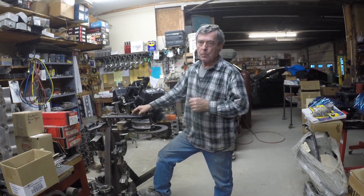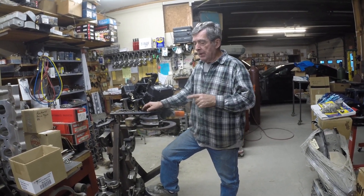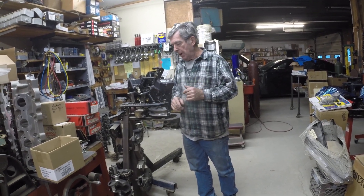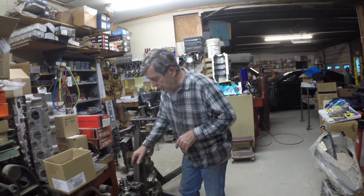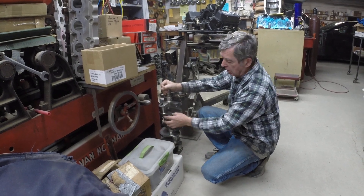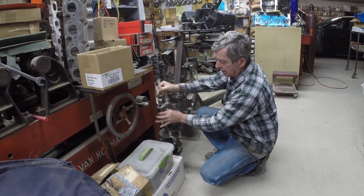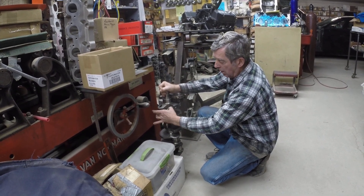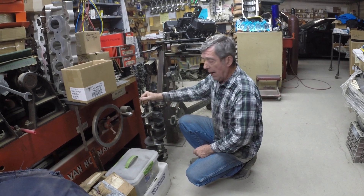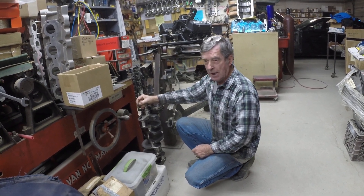To get a stroked motor, did the machine shop make modifications to the crankshaft, or did we order it with certain specs? No, it had to be made that way. Now there are people who have taken small block Chevrolets and run Honda Civic connecting rods in them — trying to spin 10,000 to 12,000 RPM. Short term, short lived, but it makes a lot of power. What they'll do is take this crankshaft — this one here happens to be for a big block Chevrolet — they'll take this journal and make it a lot smaller. They grind all off the backside and leave some on the front side. So what they did was take a stock stroke and by making the journal smaller, they removed part of the circle on the backside — now the stroke is longer. You can take a stock crank and play with it. Will it live? No. Will it make power? Yes. How long? That's anybody's guess. I don't recommend it.